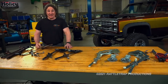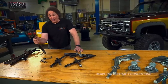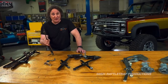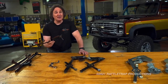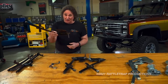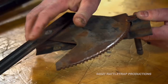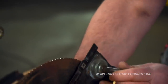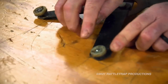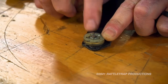With that decided, let's talk about the parts you're going to use. Anytime you can reuse original parts, you'll save yourself some money — just because they're old doesn't mean you can't reuse them. A lot of times these can be cleaned up, re-greased, and reused, but you will need to check them for damage and wear. On a regulator, check the teeth on the gears, the bushings in the shaft, and the Delrin bushings to make sure they're not cracked like this one is — that's why we replaced this unit.